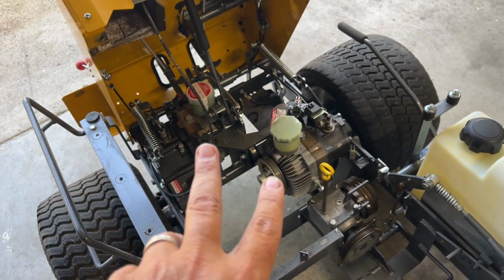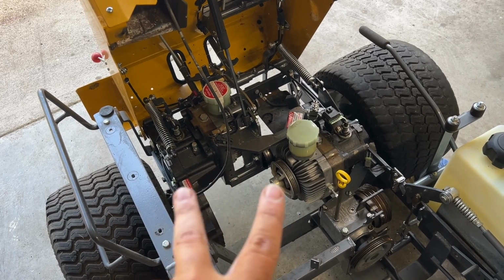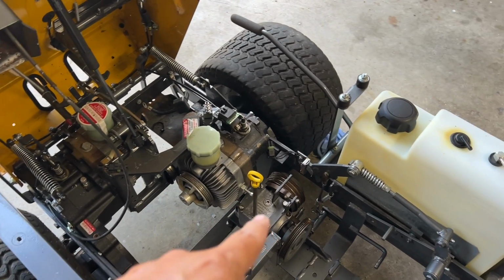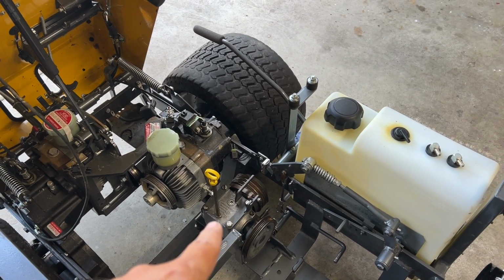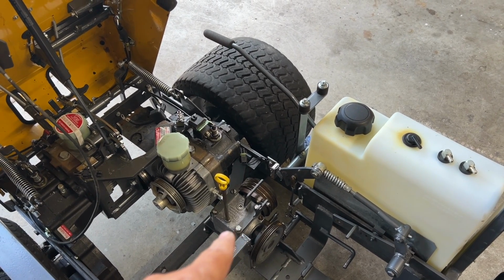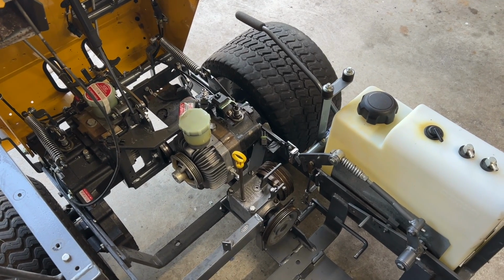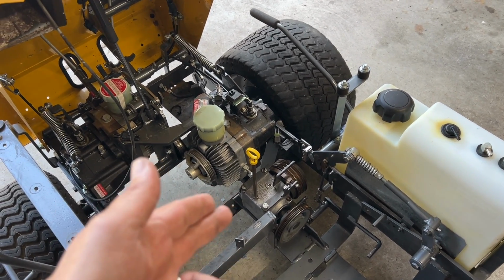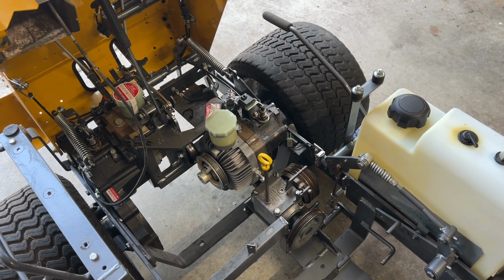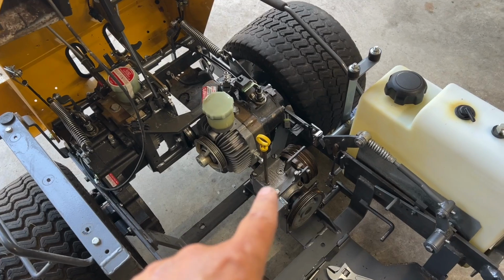I haven't done anything with the hydros. They're still just the way they were last time. We're getting there. I did pull out the gearbox for the PTO output. I pulled that completely out, drained the gear oil, put fresh gear oil in it. It's about 8 ounces, by the way. I could have drained the gear oil right in the chassis, but I wanted to inspect it, so I pulled it. It was 4 bolts, and it was pretty easy. Anyway, so that project's done.